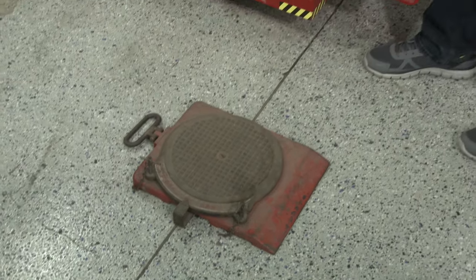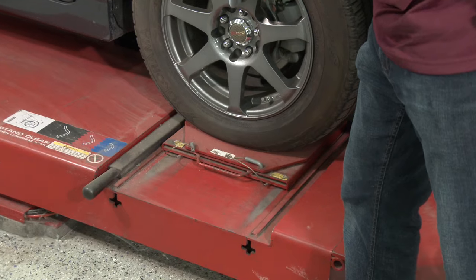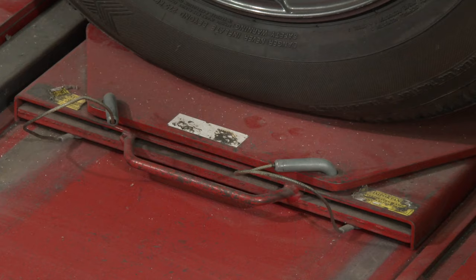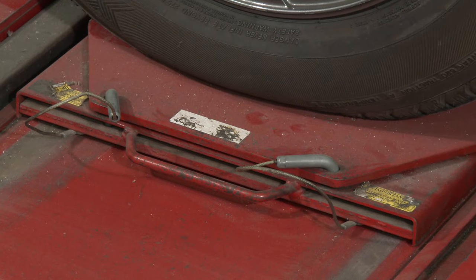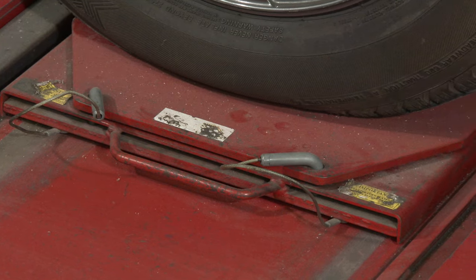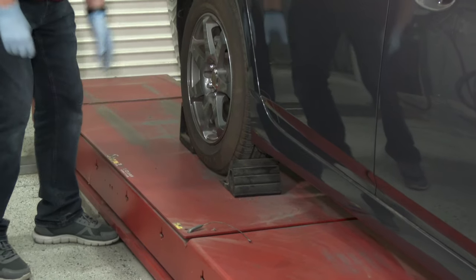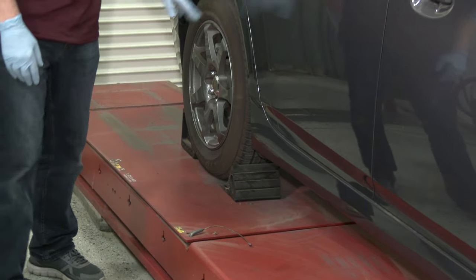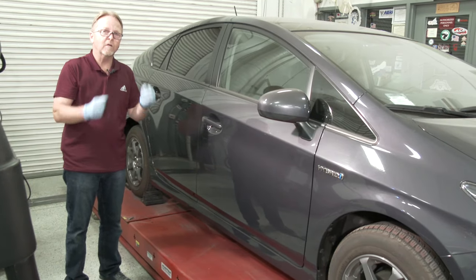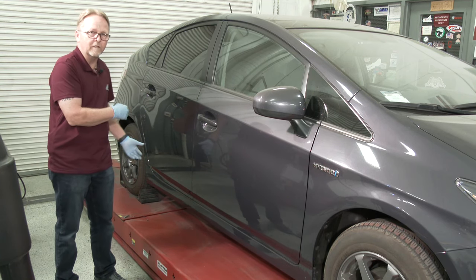You can see the car is pulled up on the rack with the turn plates centered both side to side and front to back. Make sure these pins are in the turn plates because the turn plates are free-floating without them, and it's more secure to drive up with the pins in. Go to the back and put the chocks on the tire so it doesn't roll. Leave the car in neutral with the brake off and the steering wheel unlocked so everything is movable — otherwise the car could literally roll off the rack.